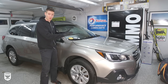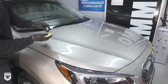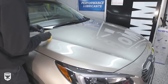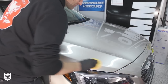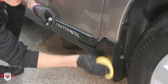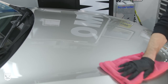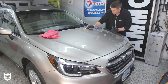So the next step is we're going to put Ammo Reflex on in two layers. The first step when applying Reflex is to thoroughly soak or prime the foam so that it's smooth on the paint and doesn't feel grabby. If it does feel grippy, then you need more even coverage on the foam with Reflex. Apply it in straight line motions and allow two to three minutes for it to cure. Keep in mind, Reflex can be used on black plastic trim as well. After about three minutes, wipe with a clean microfiber towel to remove it. Notice the ridiculous reflection after just one coat. Once you complete the first layer, give it about an hour to cure before adding a second coat.